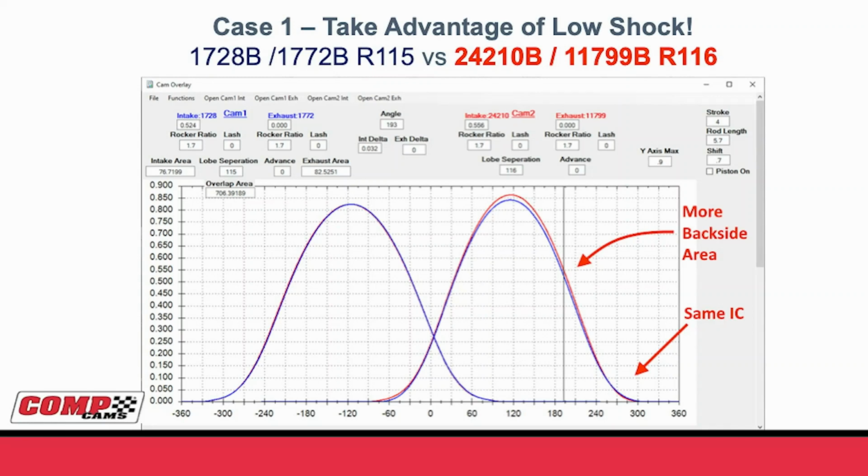A lot of people don't understand it, but there's tremendous flow while the piston's sitting there around 180 to 240 from top dead center, when it's sitting around bottom dead center. The piston's barely moving, but you still have all this momentum in the intake tract that's ramming the combustion chamber full of air. So by increasing the valve lift in this region, we're really continuing to flow in the intake stroke well after we've reached bottom dead center.